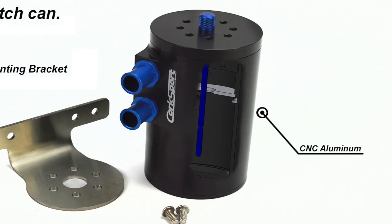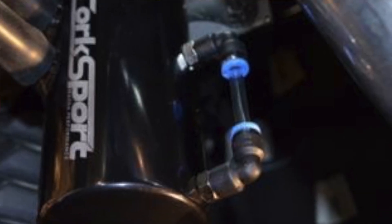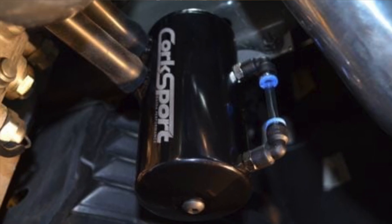Other things to consider are whether to get a dipstick or a clear tube to monitor oil level. The dipstick is convenient because you don't have to unscrew it — you can just check it in place — but that would have blown my $20 budget. The clear tube lets you see the oil level inside the catch can. Honestly it's all the same thing; I went with this one because it's the cheapest and I wanted to try it out.